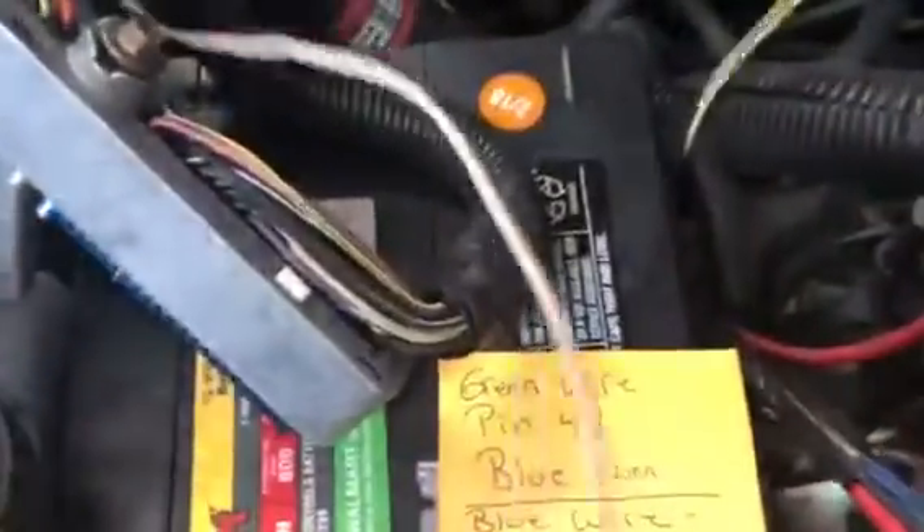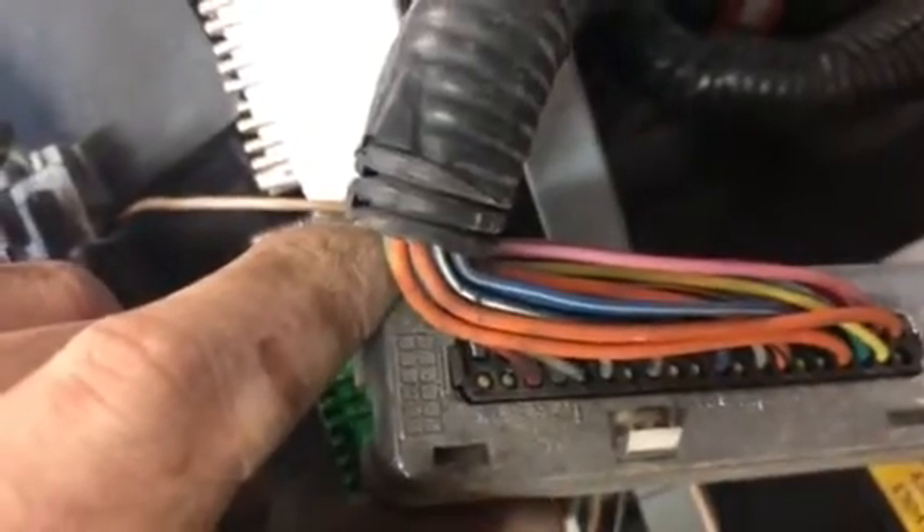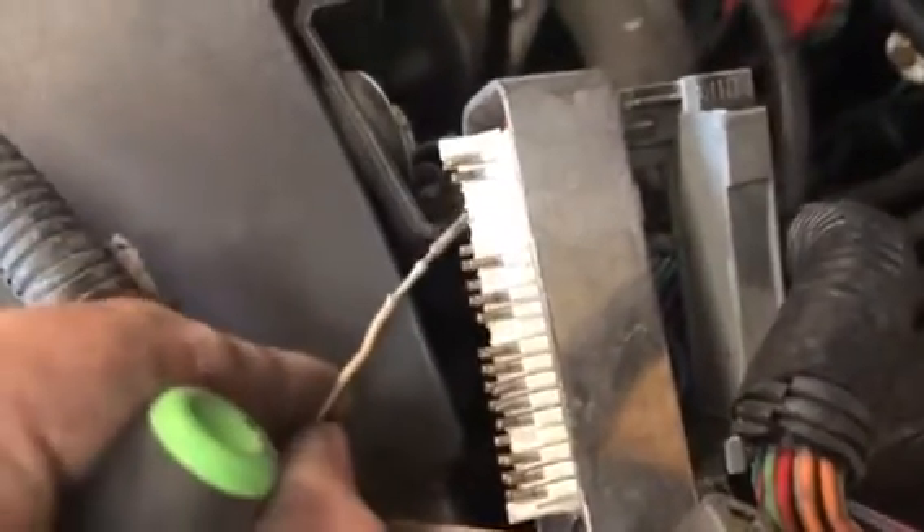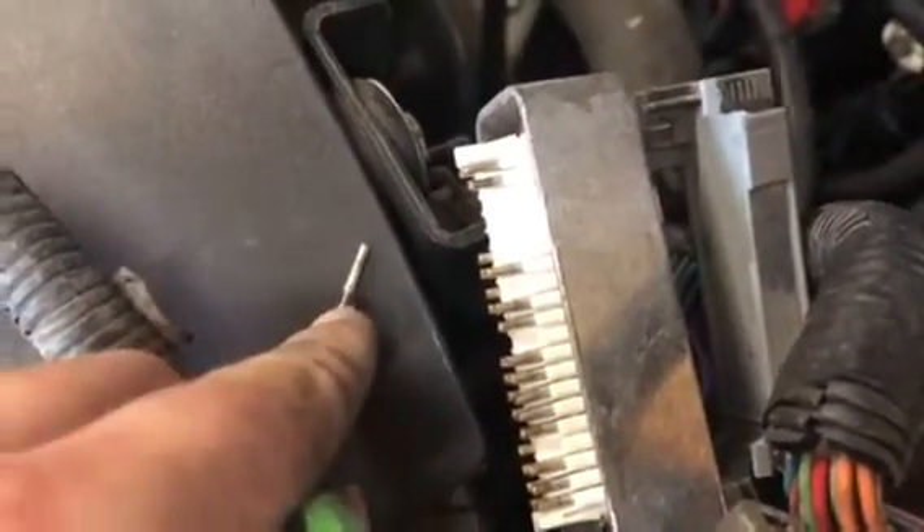They're fairly simple to do. You probably want to get yourself a flat pick tool like this, and once you go into the back of the connector — I'm not sure if I can do this one-handed here — you can see in the back of the connector there's like a rubber nipple that comes through. If you use this and go through there and kind of break it and push it through, you can kind of break that seal. Then once you insert the pin right here, it'll slide through and it's going to catch on the lock right there. Once it catches on the lock, there'll be like a little arm that comes down to that groove — it'll keep the pin from pulling out.